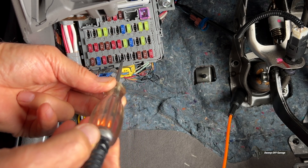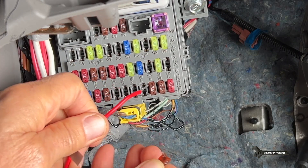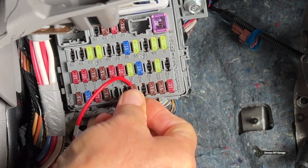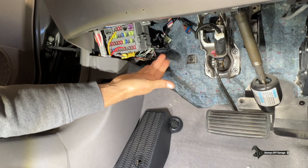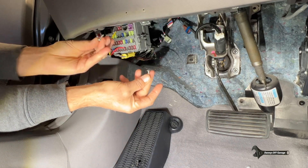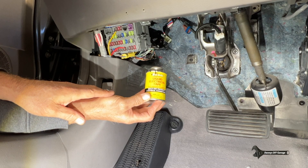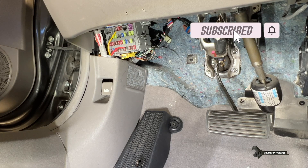So once again, if we come down here I get a light, and if I go up here there's no light. So this was fuse number seven — I'm going to put it on the circuit side. Take the fuse and just shove it in. Look over here — these are my wires, they're all resealed and repaired. And my dash cam — remember all that wiring that was hanging around here? That's all fixed. The kick panel was just two screws, one on each side. This liquid tape — I thought it worked really good. It's the first time I used it. I hope you learned something in this video. If you did, give me a thumbs up, consider subscribing, and as always, thanks for watching.